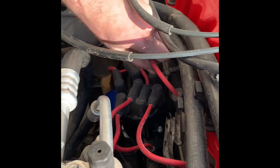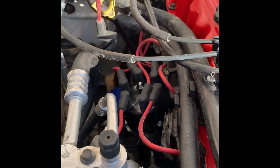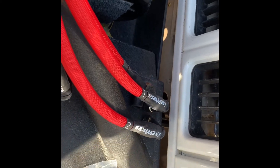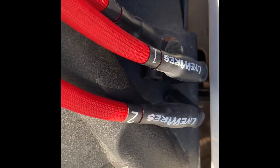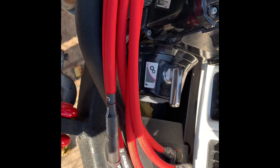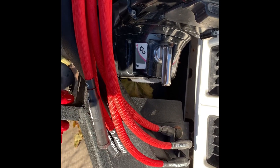We're going to go ahead and replace these wires. These were my old red wires — I wanted to replace them with live wires. You can pick the live wires up online; they are anywhere from $125 to $150 — a little more expensive. These live wires are each numbered one through six. Earlier in the video I told you to mark your wires, but if you are replacing them with these, the nice thing is they're already marked. They have heavy-duty gauge, are rated up to 1400 degrees, and have shrink wrap already on the ends.